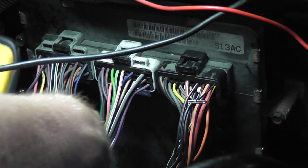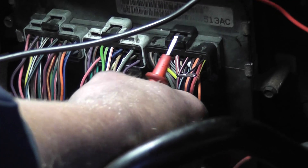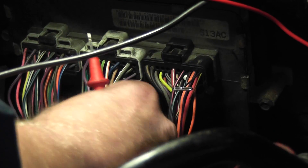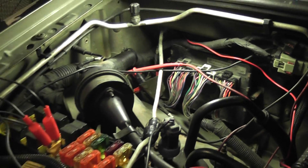So really, this car should start. We still need to fix this wire, but it's only going to be for our transmission shift solenoid, our transmission governor pressure sensor, and our vehicle speed sensor. I'm not worried about this one right now — I'll fix that later. A shorted five-volt reference will not blow a fuse, so I'm not worried about that.